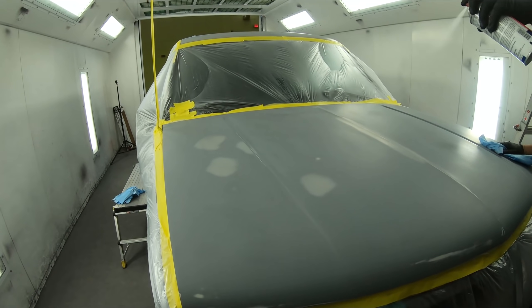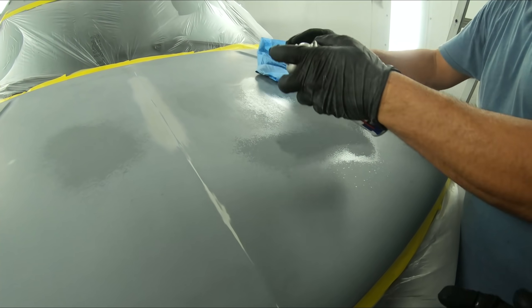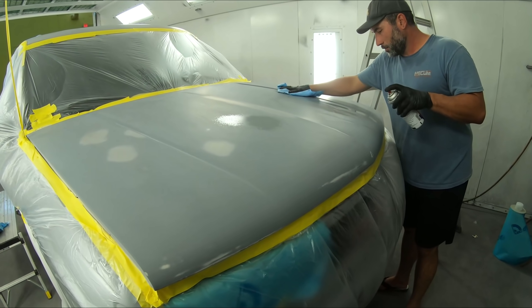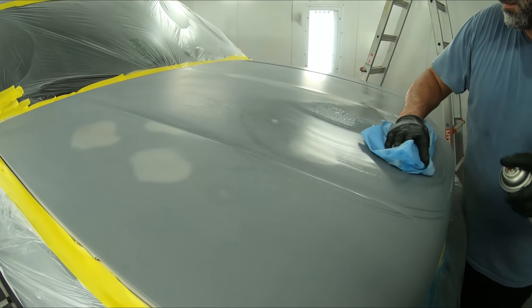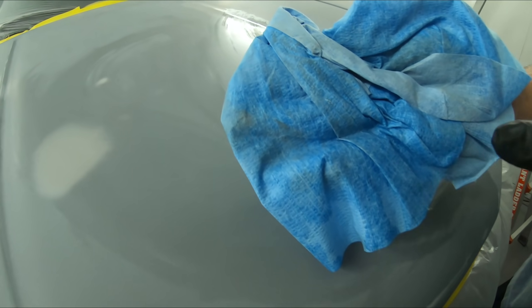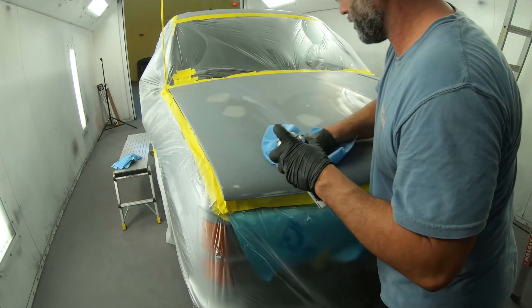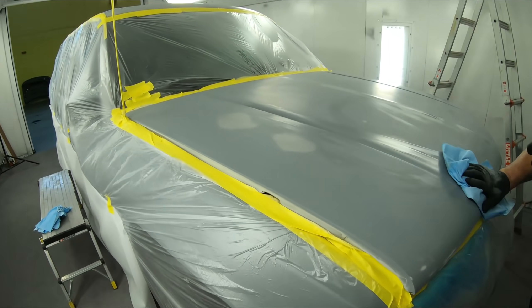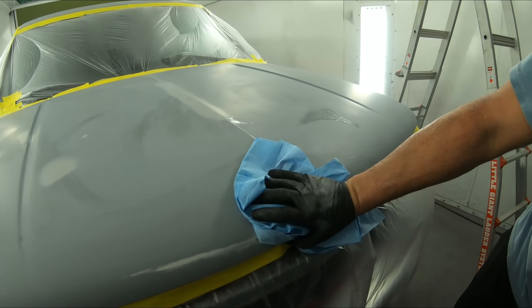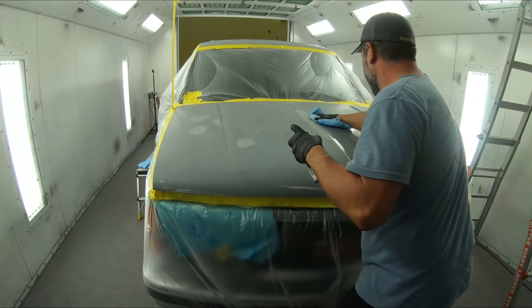All right, so we got it all masked up. Now we're going to be using the Eastwood pre-painting prep, and what that's going to do is get any last-minute contamination or issues off of the actual surface itself. So we'll wipe it all down and we want to keep wiping until it's completely evaporated. You can see even after all that we still have a little bit of primer dust, and if that primer dust is in the surface you're not going to get as clean a job as you want. Jeremy will go ahead and continue cleaning up the surface, go over the roof, and then we'll start mixing up our sealer.